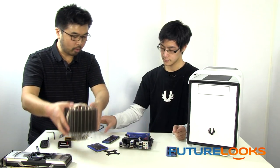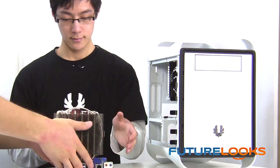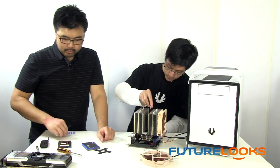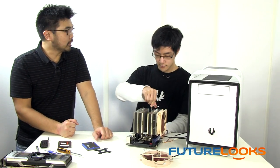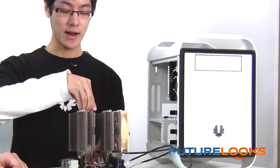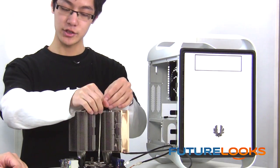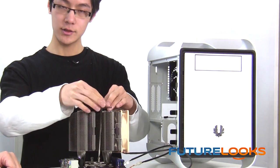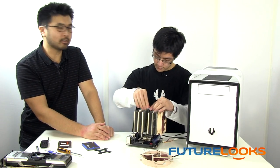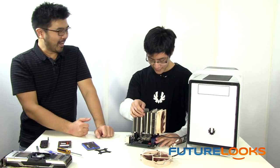There we go — let's see if this will work now. Oh, look at that — perfect! We've got good clearance; it definitely looks like it's going to work out. While we're talking about motherboards, there are a few other boards that work really well for this case, including the ASUS P8Z77-I Deluxe, which they're adding WD to the name for WiDi. It has similar socket placement to the EVGA Stinger and costs similarly at around $199. The ASUS is probably the top dog for overclocking because of its amazing voltage regulation system — really good granularity, with great overclocking capability.